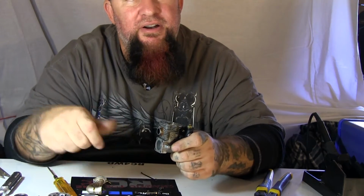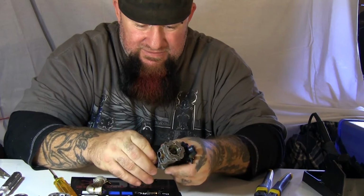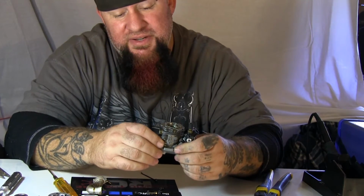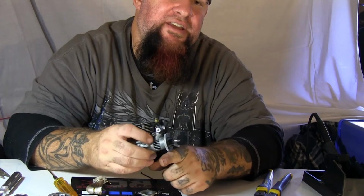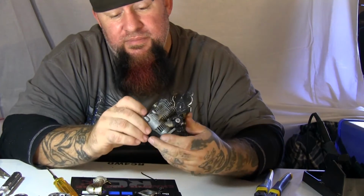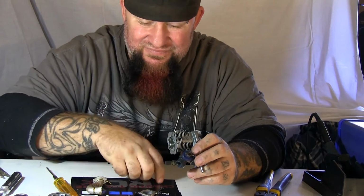This is where your pull start or your electric start would go. I already went ahead and removed the screws for that. And this one is just a close-off piece. With a bump start, all that is basically an electric starter that hits this and turns that. Pull that out, and once again, you can use a flathead for this.